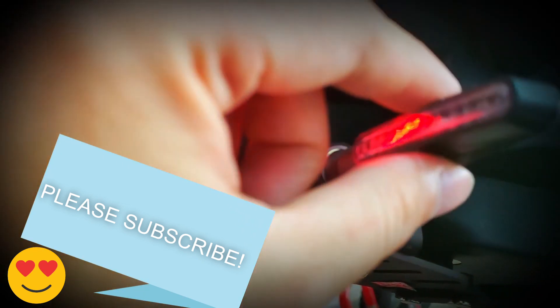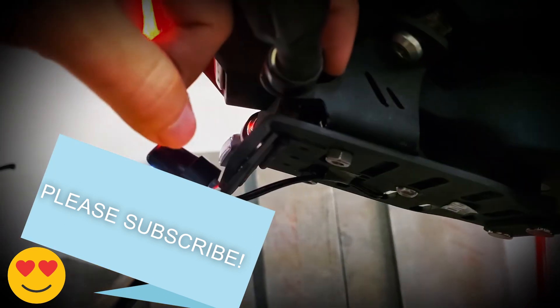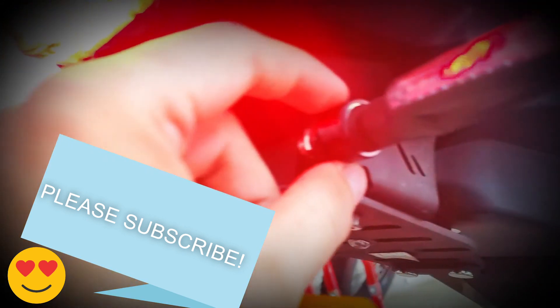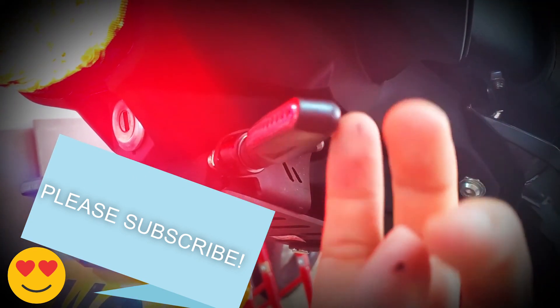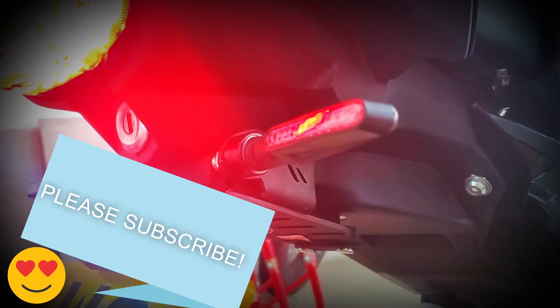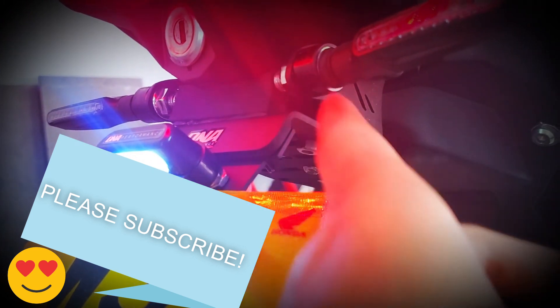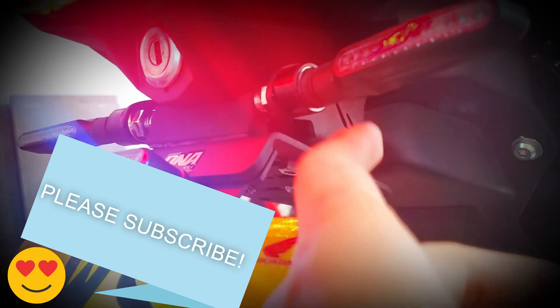The directional light is small, so it's different than the hole from the OEM, so you need to be really careful. I put an extra ring over here — a plastic ring to hold. This itself is pretty flexible; it's a rubber kind of material that prevents something from hitting it. So this extra plastic ring I added on helps to stabilize it, and I also added thread lock here.